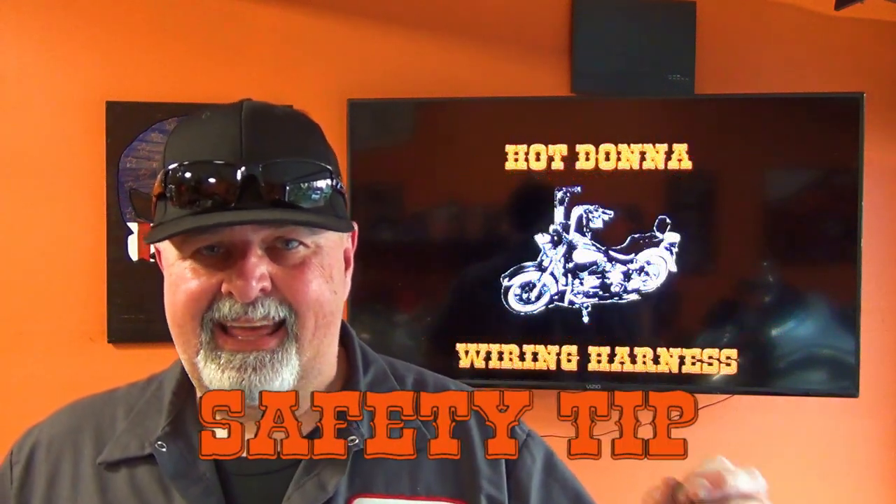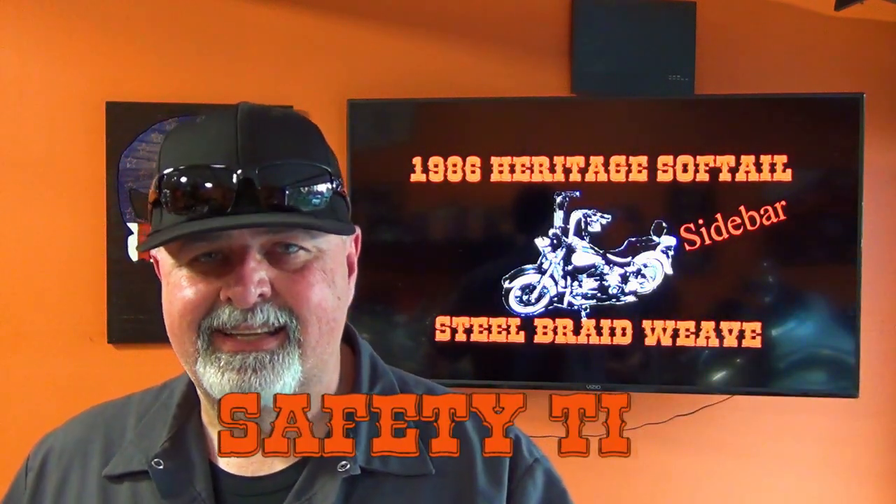Quick safety tips: this airplane paint remover is not as potent as it used to be. Back in the day you could pour it on the floor and it'd take the paint off a car at the end of the driveway. Do this in a well-ventilated area — we've got the garage door open. Even though it's toned down from what it used to be, it's still flammable and will still cause respiratory distress if you get enough of it in your lungs.